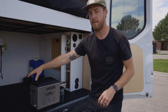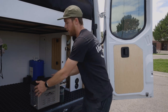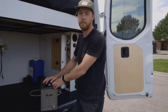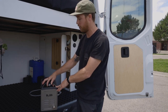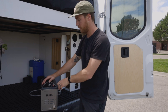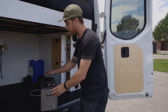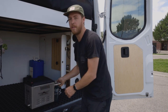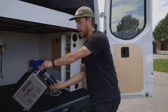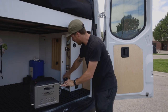On the face of the heater, there's a temperature dial on top — keep this on max all the time for good hot water flow, and do your temperature adjustment with the knob on the shower handle. There's also a power on/off switch for the igniter. When you're not using the heater, disconnect the propane — the last thing you want is for it to rattle loose and leak while driving. Store it disconnected, right underneath the shower controls.